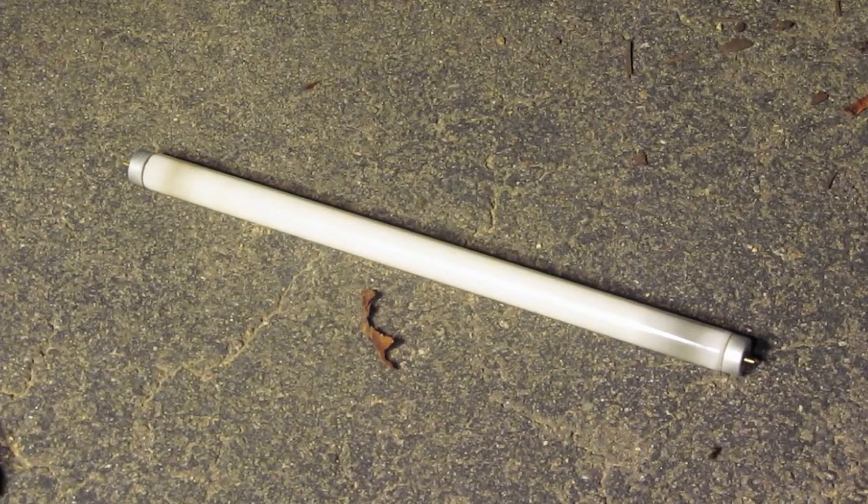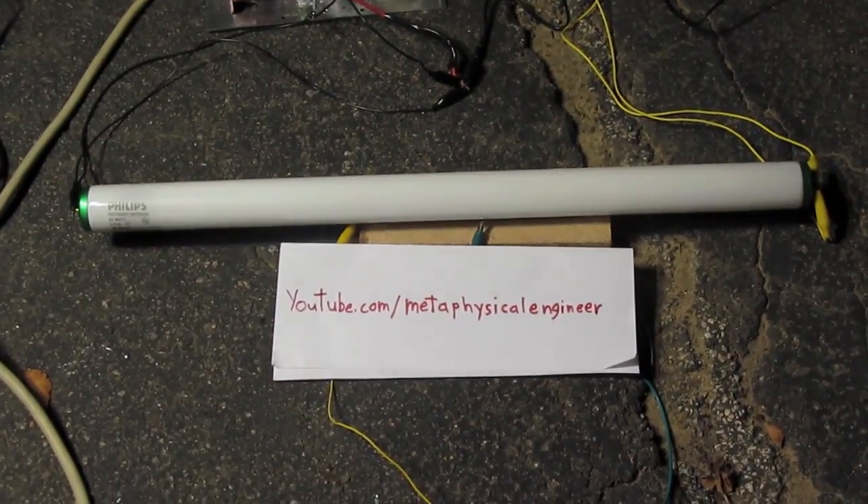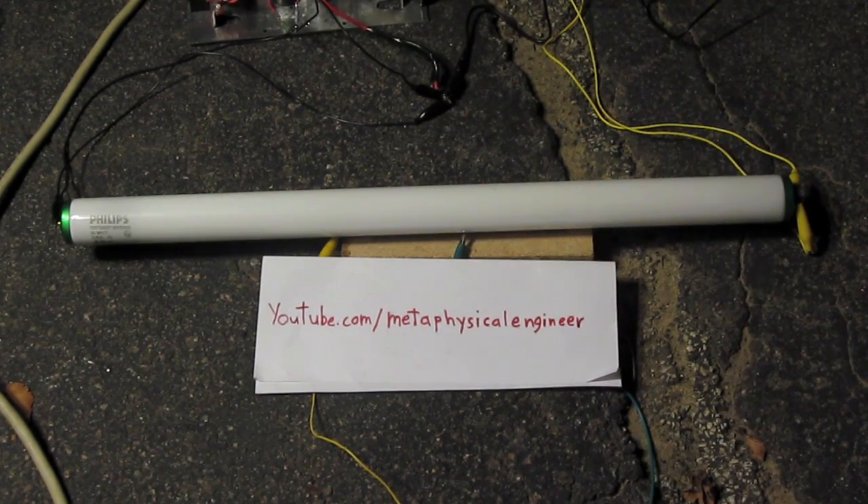It would appear that the tube that took so much abuse last night without seeming to falter has developed a microscopic leak on the bad end and no longer has vacuum. So it has robbed me of the chance of spectacularly finishing it off tonight. However, I have this tube — an F20-T12. It was over the kitchen sink for about a year, nice high color rendering index, but it is defective. One end lost all its emission coating after just a year of use in a preheat fixture, and it no longer works. So I've decided to send it off in whatever way I can.